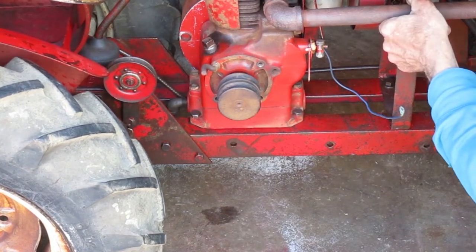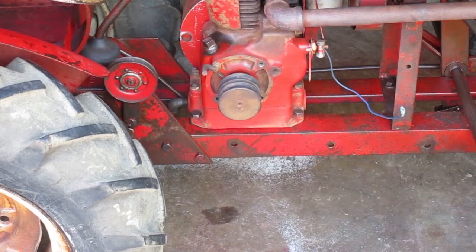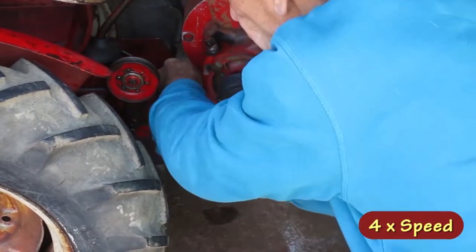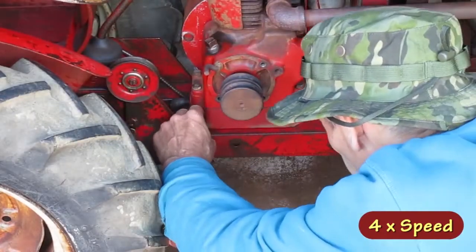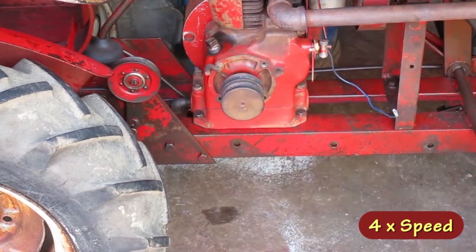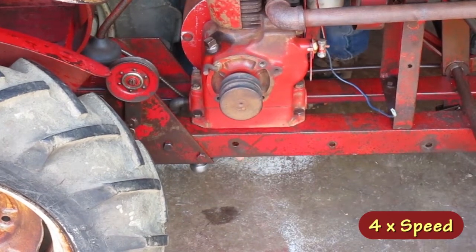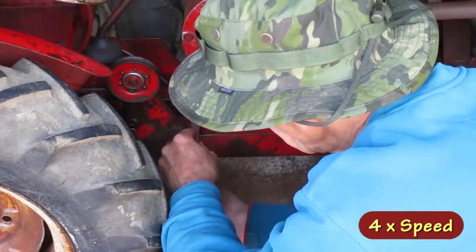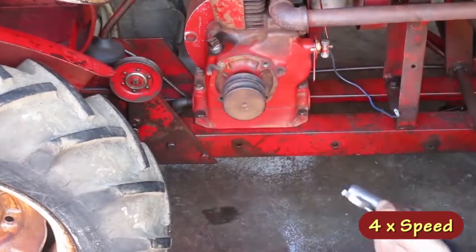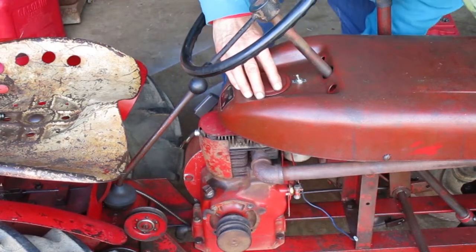On these tractors, you want to make sure the exhaust pipe is against the frame when you tighten the engine bolts, so when you put the exhaust clamp on, it won't be on a bind. Now I'm going to take advantage of the spark plug access hole.